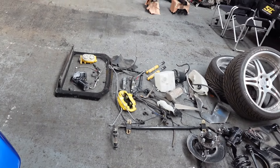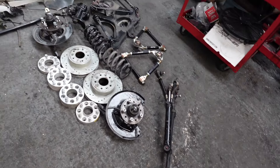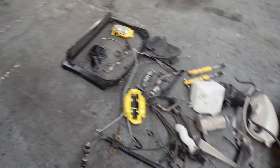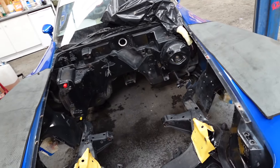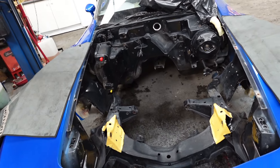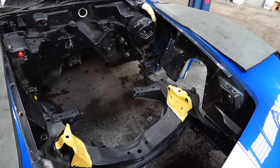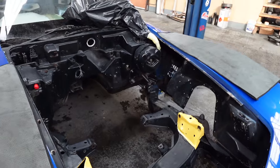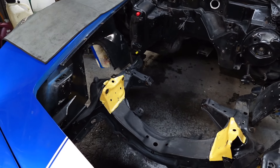Alright, so I've been working on the Corvette and I got the whole engine bay stripped. This is basically all the stuff out of it — we took the front suspension, the knuckles, steering shafts, upper and lower arms, springs, and yeah, brake lines — took everything out. I have it stripped back now. We're going to scotch it, clean it really good, then pressure wash it. After we pressure wash it, we'll bring it back in and probably scotch it some more depending on how the first pass goes.